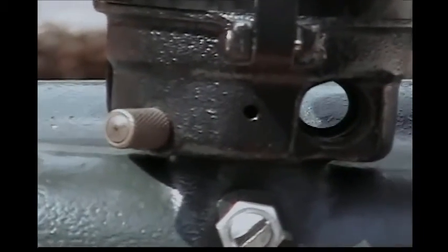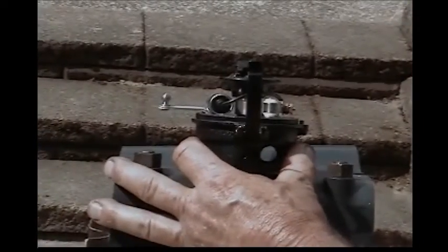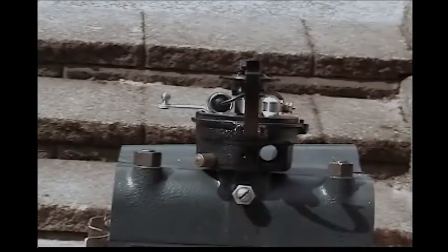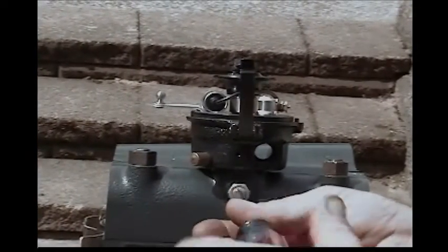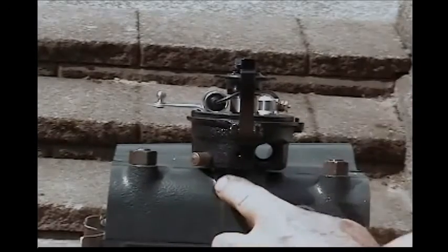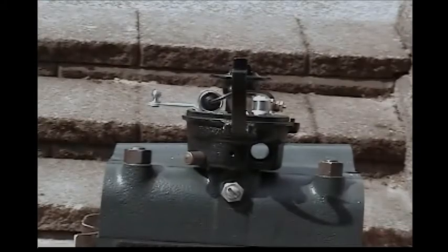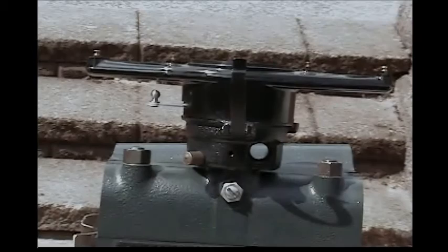As soon as that's in there, you're good. If it doesn't go in immediately, you can take the cap off and rotate things around to help facilitate getting those two to mate together. Once they're in, take your flat blade screwdriver, tighten the distributor in place, and then tighten the lock nut with your 9/16 wrench. Your distributor cap can go back on at this point.